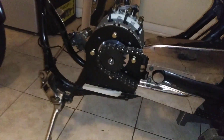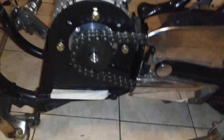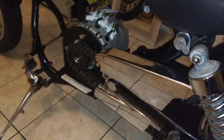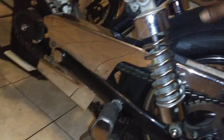On the brushless motor side, I got an 18-tooth sprocket — number 50 sprocket, which is equal to a 530 pitch. So that's what I've done so far. I haven't bolted the motor down yet, just got it in position, kind of mocked up, so I can make adjustments as necessary.